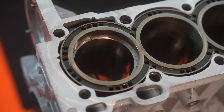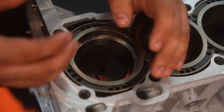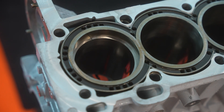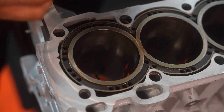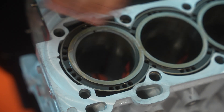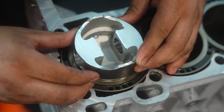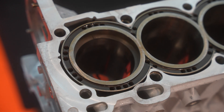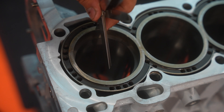When gapping the piston rings it's very important to take your time. It's better to take an extra 20-30 minutes and have it done perfectly than to gap them too big and need to buy another set — that's just more delays and more money. I'm also doing the second compression ring now: bevel from the outside, writing on top, a little bit into the groove. In my case I need 0.018" — a snug fit, not loose, just perfect.